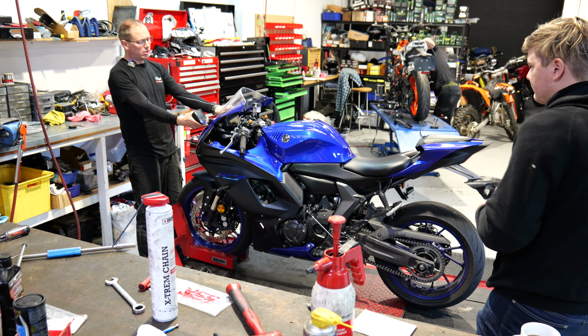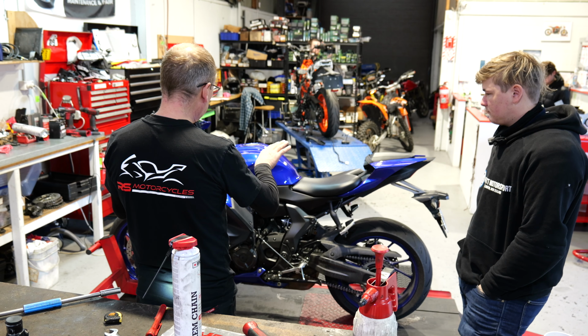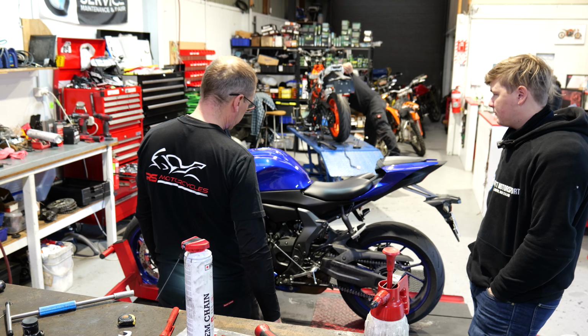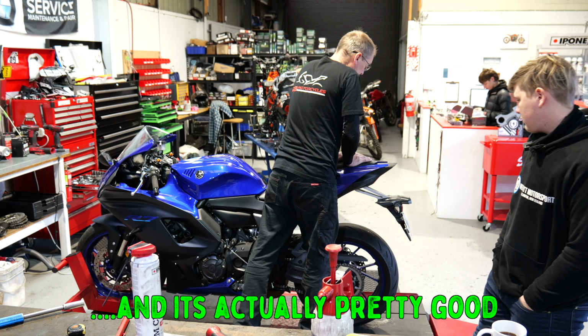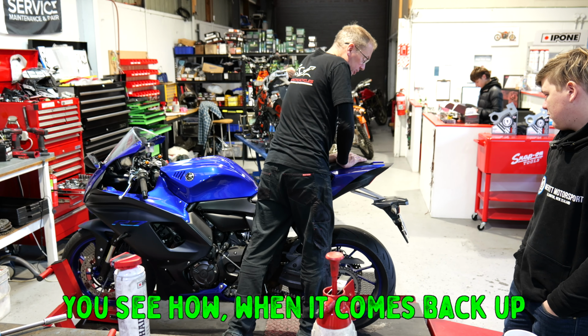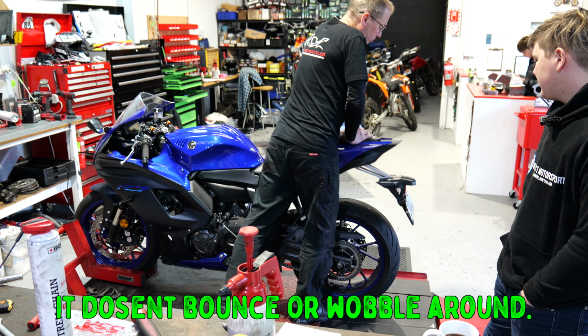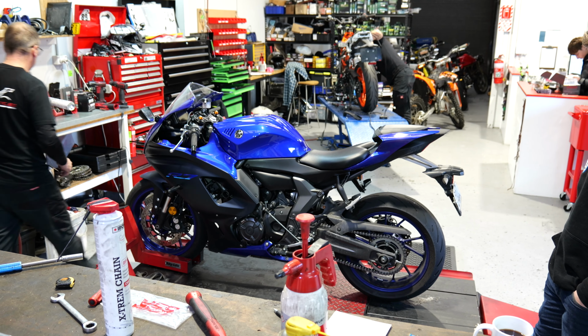So what we're looking for is control. Yep. And we want it to go down and come back up smoothly. We don't want it to bounce, we don't want it to kick you around, throw you out the seat, that sort of stuff. So first off, we're going to have a look at the shock. It's actually pretty good. You see how when it comes back up, it just comes back up and it stops. It doesn't bounce and wobble around.